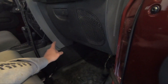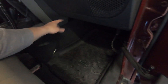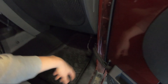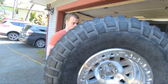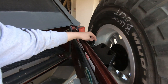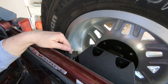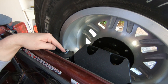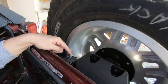On my VHF I had run the cable across the top bar, down the A-pillar, and along the side. With this, we'll probably have the control box under the dash, so we'll start roughing in and routing the antenna cable under the plastic panel and around to the back. We're going to use this generic fish wire that we left when we installed the tire carrier — it's going to help us pull the cable through for the antenna installation, since we have an antenna mount on the Evo carrier.